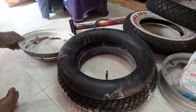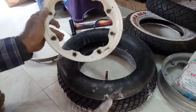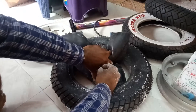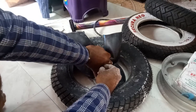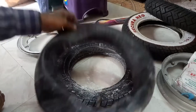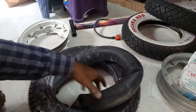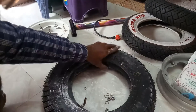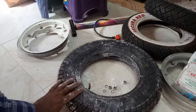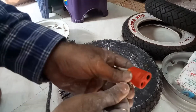Take the tube. On the wheel rim you will find one hole — the inlet of the tube will come through this hole. Keep the inlet point facing in the correct direction, matching the direction of rotation of the wheel. The important point is there should not be any twist in the tube while fitting — it should be free of twists.